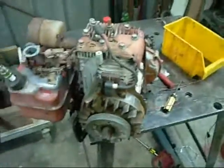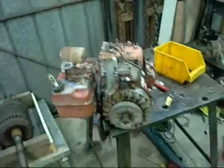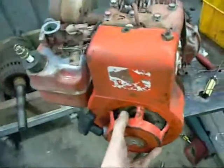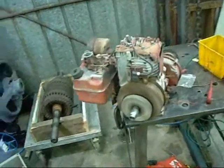Just need some fine tuning. You can shave 2mm off a Briggs & Stratton head and it'll still work - that's actually pretty good. I'm using a new head gasket too. So far all it's cost me is $15. I've got a secondhand cowling here with a good pull start on it - it's a lot older than the engine itself but it'll work. The high compression makes idling a bit hard but it works.